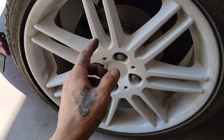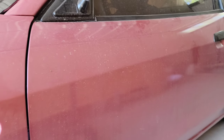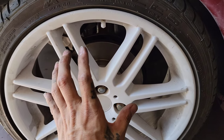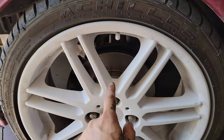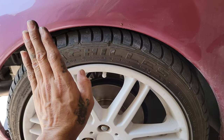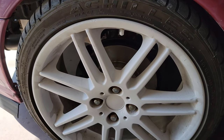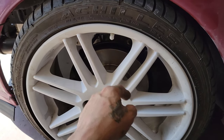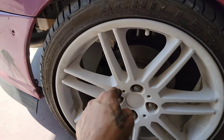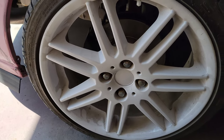And so yeah, the brake rotors themselves for a Mitsubishi Mirage, like a DE coupe, a two-door. On this model, it has the 9.29-inch diameter. And the ones that come with the 14-inch stock wheels, those have the 10.08 diameter rotors. So I'll leave the links for these rotors and brake pads themselves in the description so you guys can find them if you need them.